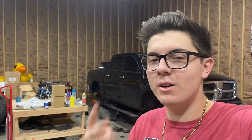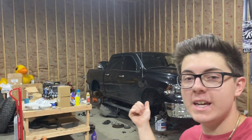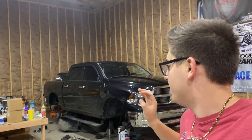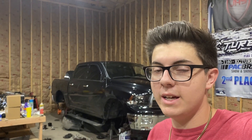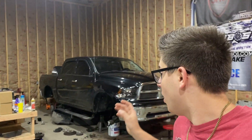Welcome back to the Just Knock Smith channel. You're tuning in for part four on this Ram 1500 truck build. We're doing a six inch Rough Country lift with a 1.5 inch leveling kit, so the truck is going to be at seven and a half inches of lift on a set of 26 by 14 Hardcore Chrome wheels on 35s with two inch spacers — pretty much like a 26 by 16 on a 1500.